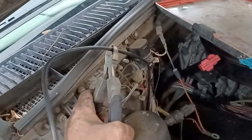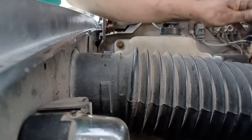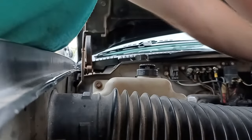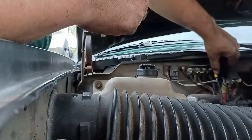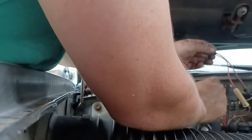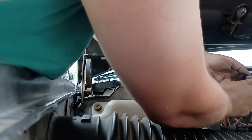No turning back now — brand new wire, just bought it. It hurts my soul. And there was this one which also looks pretty damn clean. This is what I meant when I said that the first thing off the battery was the lights and the engine bay — that's what this is. It's on that same post, it's the only other thing on that post. So that was a pretty clear indication that there was an issue.